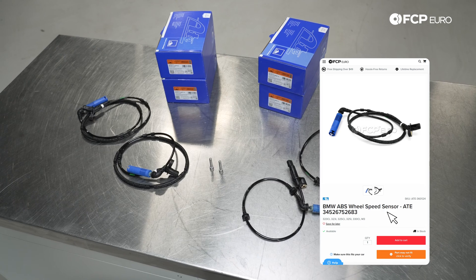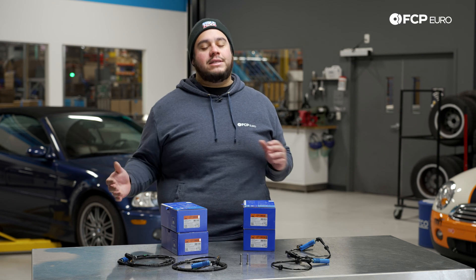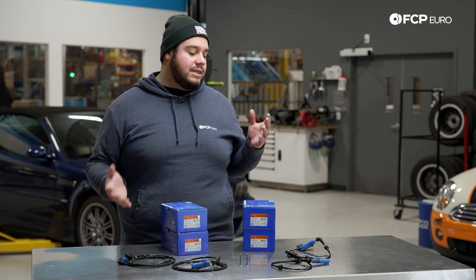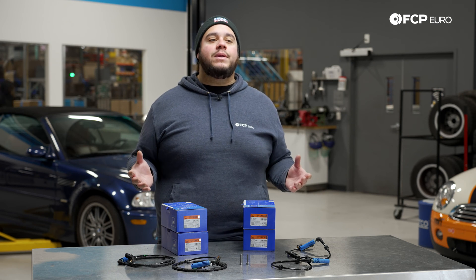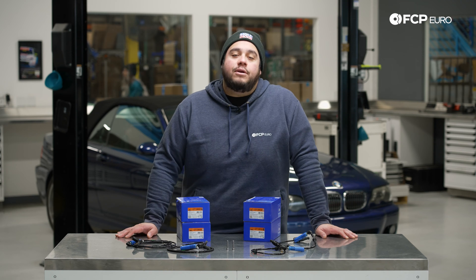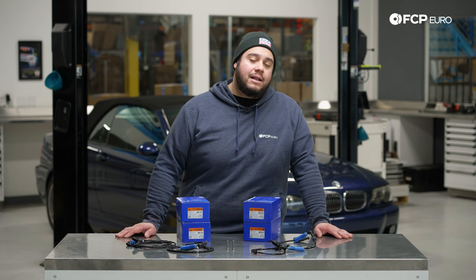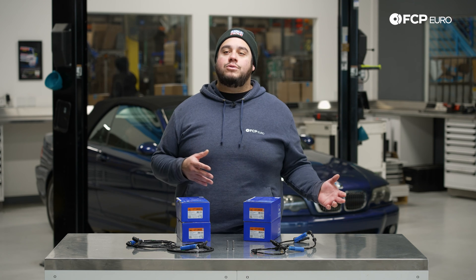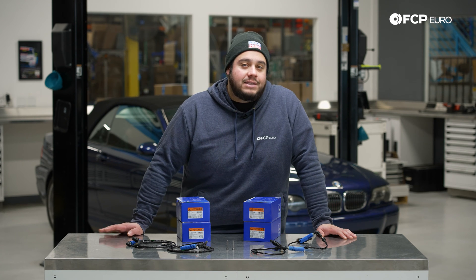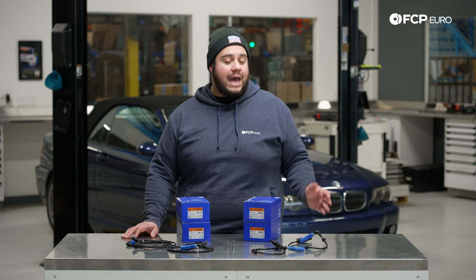We also have some hardware. Should the hardware on this vehicle be a little bit crusty, just keep in mind that oftentimes the hardware can change from a Torx head to a hex or vice versa. Typically when these sensors start going out, you're going to get an ABS light on your cluster. The easiest thing to do is simply scan the vehicle, read the live data, and see if all four wheels are registering. Usually when one goes out, you'll have a zero or no read at one of your wheels, sometimes more than one at a time. Keep in mind you can also get that light from a bad ABS module, pump, or anything related to the braking system. For today, this vehicle has two sensors out — one front and one rear — and the steps are going to be pretty much identical for each corner. The only thing that changes is how the wire is routed.